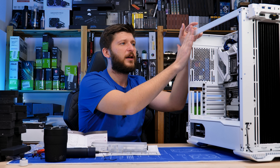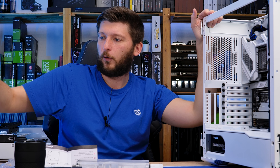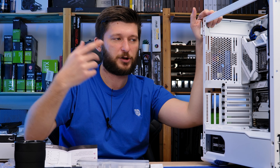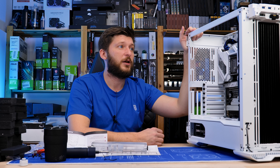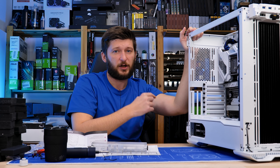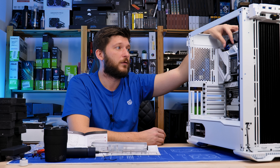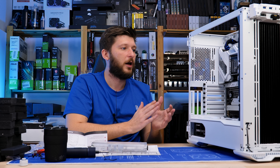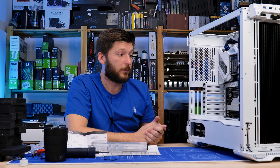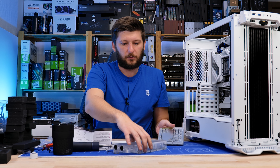In the meantime I also planned ahead and analyzed what I forgot in the last six months, and I think I figured it out. Not having that secondary radiator in the front-top does have something positive to it. First, the loop is way simpler. Second, I gained essentially a whole bunch of 90-degree fittings, because originally everything was planned with 90-degree fittings. I can now daisy-chain a bunch of them to reposition tubing, so I might only need to bend maybe one or two tubes — the rest will be done with fittings.